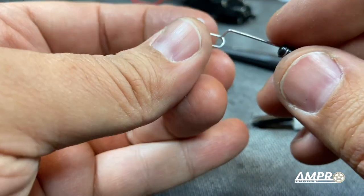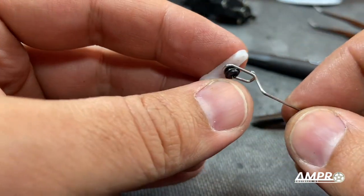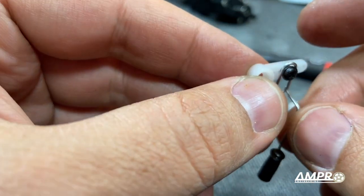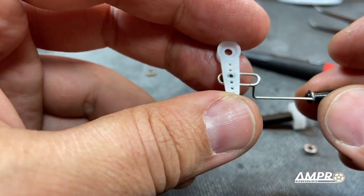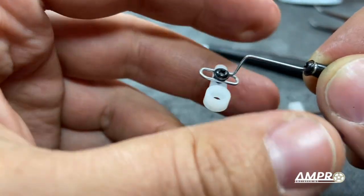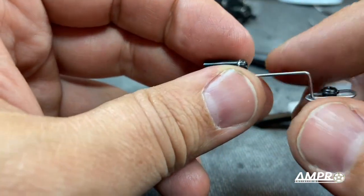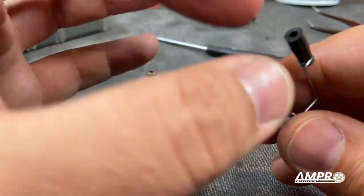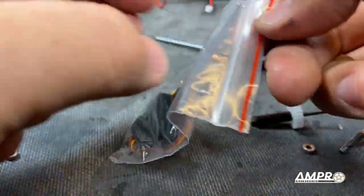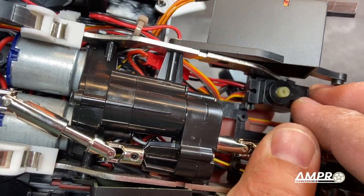I reached out to my buddy at LDRC and this is what he told me to do. This kit came with this little rubber tube — I cut off about two millimeters of it, ran that through this flanged self-tapping screw, and placed it through hole number three. I think we're going to have to alter that depending on how it works in the car. So that holds it together and allows for a little bit of play, since there's no end points on this channel. And then here is this little conical-shaped piece — again, the flange screw there, and just run it like that. So this is what's going to pull on that shaft. Not too thrilled about how this is designed, but we'll see how it works. We have this servo that it came with — that's where I got the servo horn from. So we're going to install the servo. From under the car, it will go right in here. There should be two extra screws that came with the kit, so go ahead and screw that in right there.